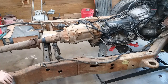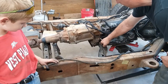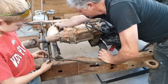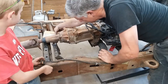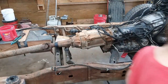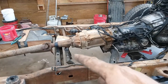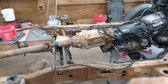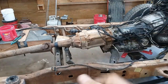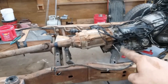The next thing we're going to do is take the transfer case loose from the crossmember, and then we're going to jack her up a couple inches and stick a two-by-four block underneath the tail shaft or transfer case — a two-by-six block, or whatever that block is. Now, this next step is kindly important: you want to jack this thing up as high as you can get it, and it's going to bottom out on the body if there's a body here, then block the tail shaft up and take out the crossmember.